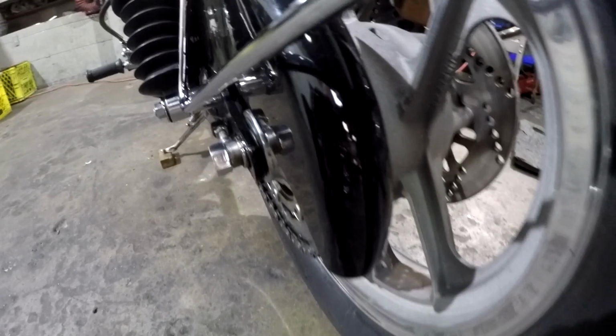Got your Triumph chain guard here as usual. So, over here, it's easier, same as the other bikes. This relationship doesn't change because this relationship here does not change. So this spacer stays the same. If you need to adjust anything on this side, you take it off your caliper mount here, off the face of this, or add a washer to it. And there's your Ninja wheel.